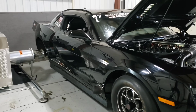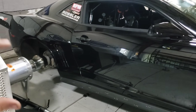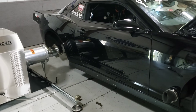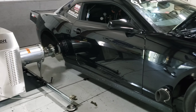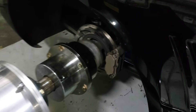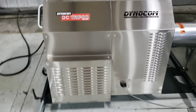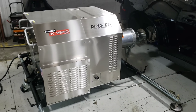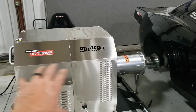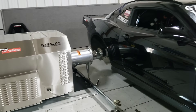The Hub Dyno — if you are doing any kind of chassis dyno work, you're strapping the car down, you've got tires on a roller, the roller's knurled. You might see videos with tires spinning and all that. Absolutely no slippage here, because this is a mechanical connection directly to these 5,500-pound pods — Dyno Com calls them pods — one on each side. These are movable. You take the wheels and tires off, hook up directly to the axle — that's the Hub Dyno.